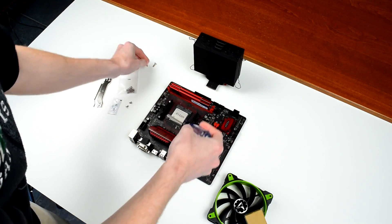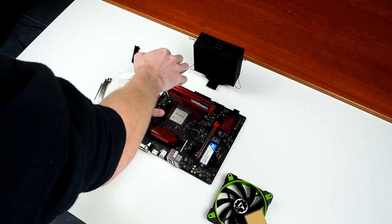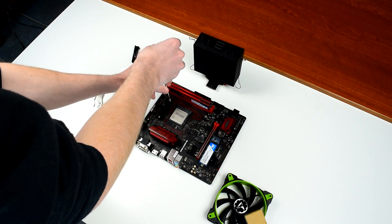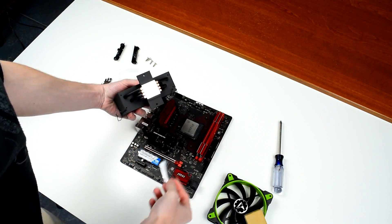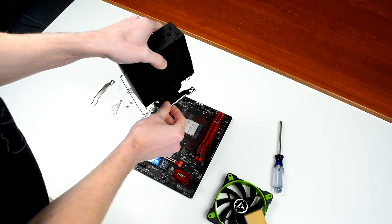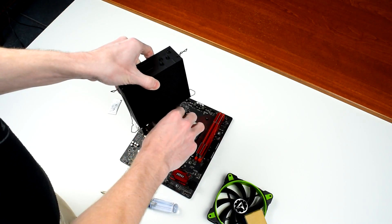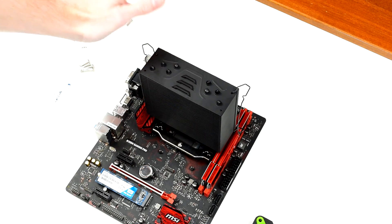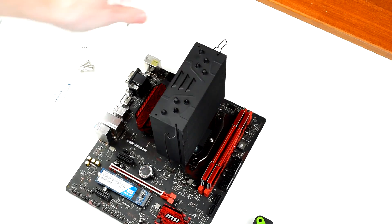Next, you'll need to remove the AM4 mounting clips from the motherboard if they're not already off. I do like coolers that install with the stock mounting clips, but those usually only allow horizontal installation with the fan exhausting toward the top of the case instead of toward the back. Important bit here: don't forget to peel off the plastic protector on the bottom of the heatsink — it's pretty hard to transfer heat through plastic. Next you need to attach the mounting brackets to the heatsink. The first time I put them on I had them arching out away from the tower, which is backwards. Fortunately they're held on with just one screw, so flipping them around isn't a problem. The Esports One actually can't be installed horizontally, it has to be vertical, which is good since it exhausts toward the back of the case.